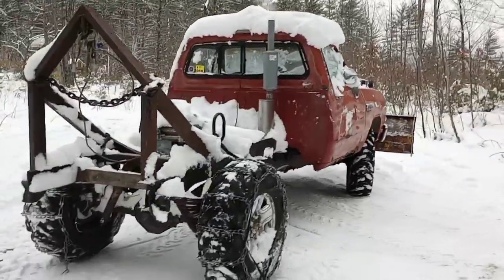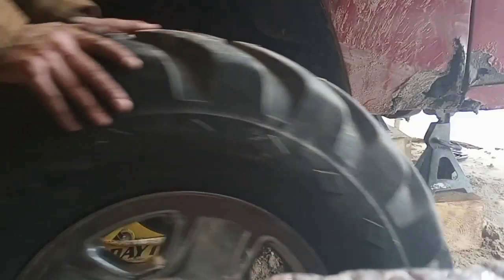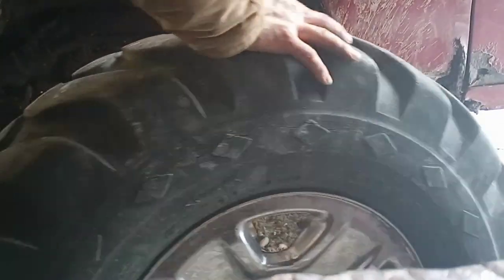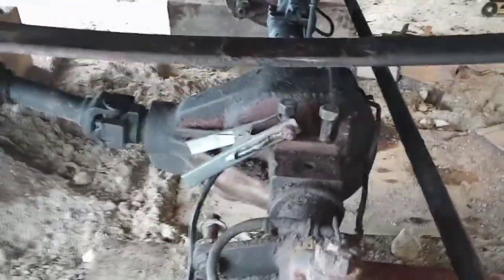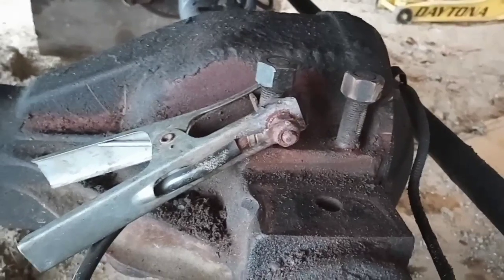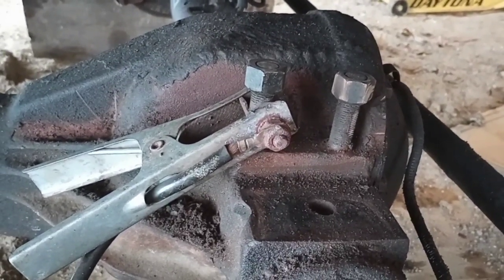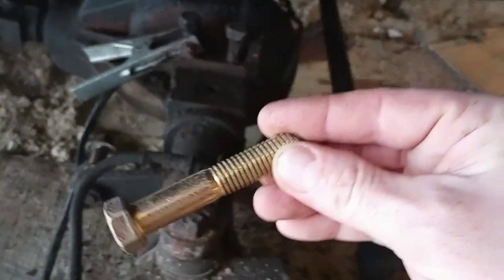Yeah, it's official. I'm a redneck. I'm trying to get these 40-inch tires to fit. All right, so when you lift these first gen Dodges with the Dana 44, they have studs on the inside of the leaf spring plate instead of a U-bolt. So you got to remove these studs, and they send you a longer, oh, it's just a bolt, grade 8 bolt.